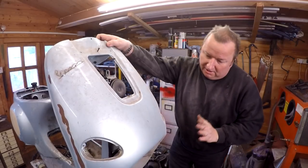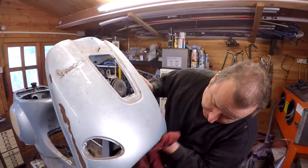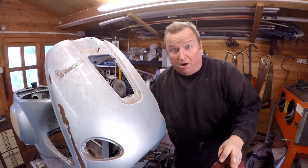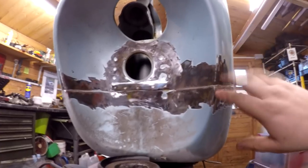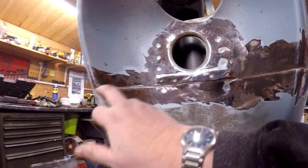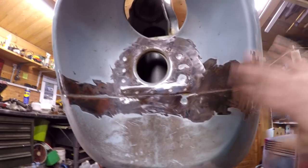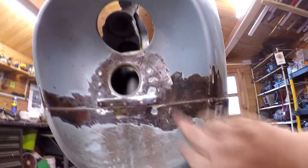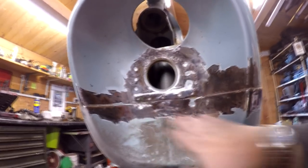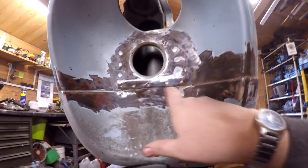Okay, that's probably the worst bit ground away. Let me just get a bit of cloth just to show you what we're left with. Now again, this has just had the first part of the rust removal. As you can probably see, we've got some pitting — nothing's actually gone through — but we've still got this crease to dig out. Most of the rust has been removed now, but what I'm going to do is also paint this surface with the Vactan treatment, our rust removal treatment. I'll give it one more sand down first with some 80 grit, just by hand, and also dig this crack out.